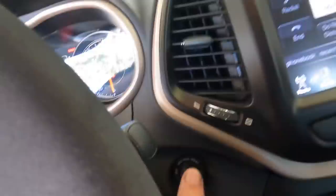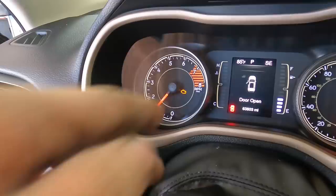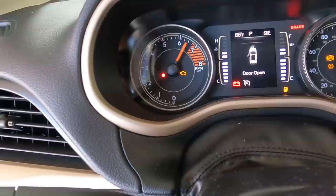All right, Jeepish thing, turn back on. Starting engine now. Let's get back into our code menu, clear those out. Restart it again. Clearing codes now. Light's gonna go away. Goodbye, light. Erasing. Oh no, it's not successful. I had the engine running. Try again. Failed to follow directions. Clear codes. Yes. Code clear. Success. Restarting engine. Booyah, no check engine light.